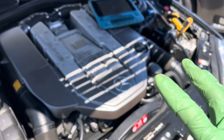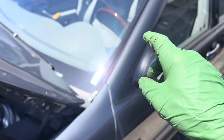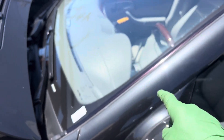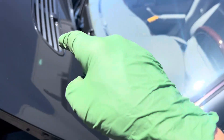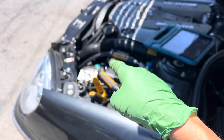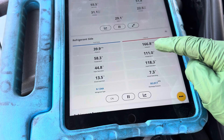You have the option for both charge quantities — front only, or front and rear. This one is being loaded up with 150-degree interior air. I'm in recycle mode because I don't want the cooler outside air — I want to load the hell out of the evaporator and make the pressure go as high as possible. Look, it's come down to 166 psi on the high side.